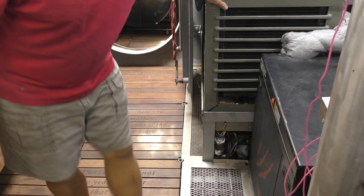So that is better. Many thanks to Andy for taking care of the engine. It's always nice to have it running better. We're gonna set a baseline now. This is gonna be like a starting point for us, and we're gonna do that with a bollard pull test. We basically tie this ship to the tree, put it in gear, put it up to like 1500 RPM, something not too crazy, and see how much power she pulls with. That'll be of interest because it's a baseline for us.